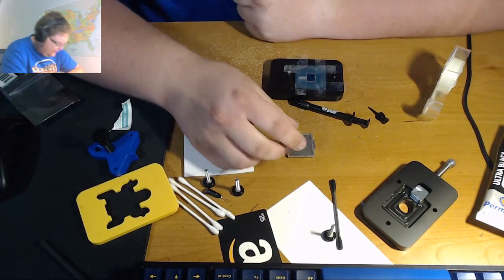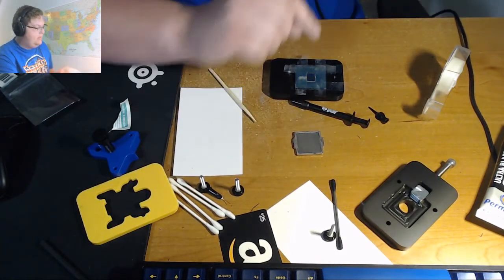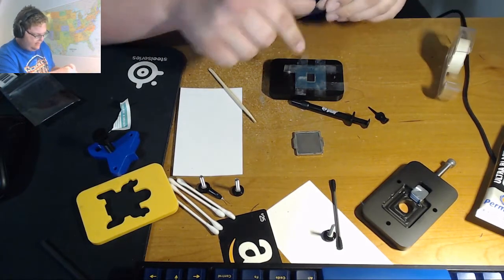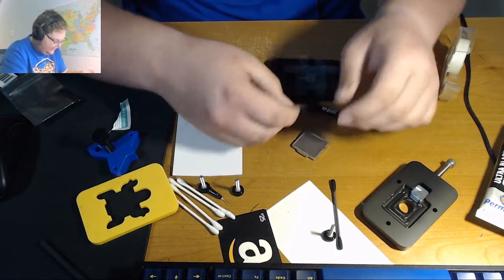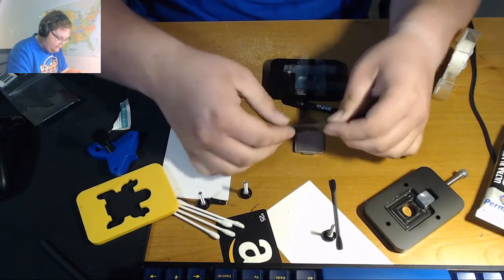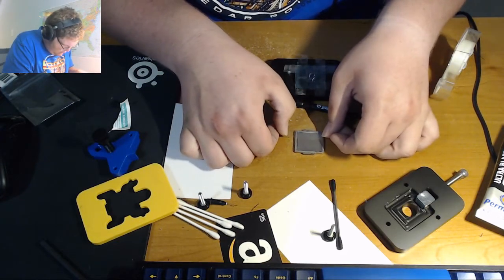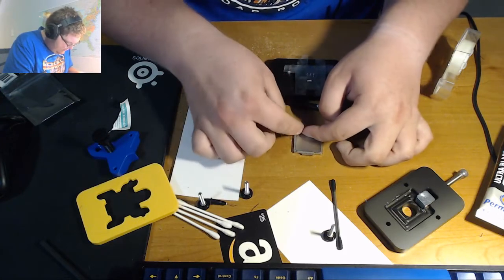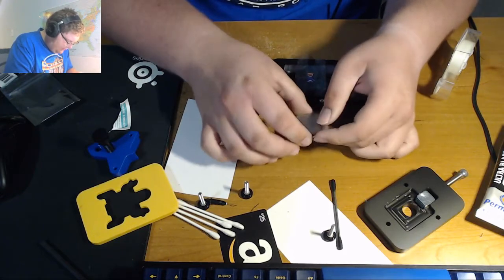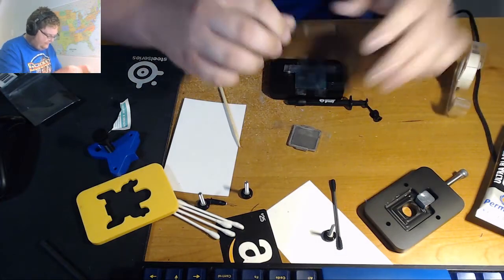And then you're going to want to do the same process on the IHS. So as you can see, there is a faint, well, you probably can't see it, but there's a faint little outline of where the thermal paste used to be. So we're going to use that as a guide to place the tape, just so I can see it when my hands are in this position. Just going to eyeball it. This isn't quite as important, but we're going to be covering it anyways.